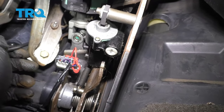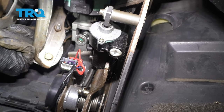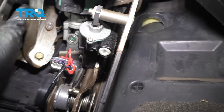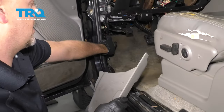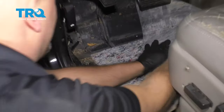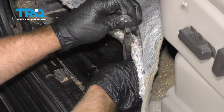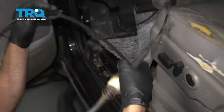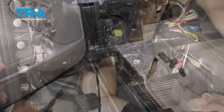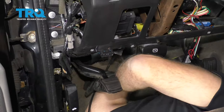Underneath here there's a spring that's still holding this cable from coming out. I need to take this bolt out right here, but you have to get it from the backside. Use a 10-millimeter socket and a ratchet to take that out. This piece right here — just slide it out. This piece is broken, but normally there are clips right there, so you're going to have to pop it this way. Just be careful of the handle. Then under the carpet, fold it over right here. You can pull this through — you're just going to have to fish it behind that spring, kind of like a retainer, and it slides right out.